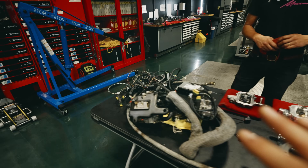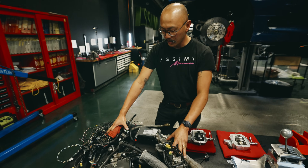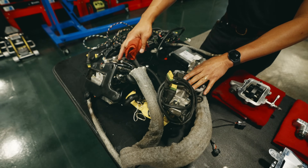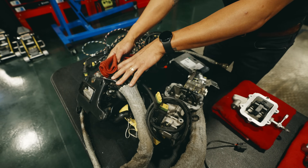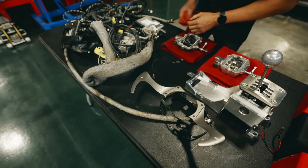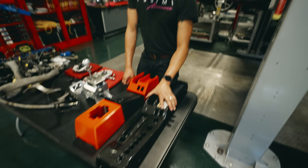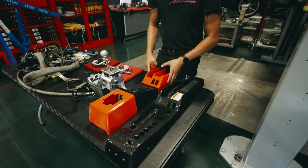Essentially, we've got the F1 system here. This is mostly all the components that come off the car and stay off the car. So you can see the harness here, you have the main power system, the actuator, the F1 accumulator, reservoir, pump, solenoids. You have these pretty little paddle shifters and the ECU. Also the original center tunnel, which we'll go through in another video in the process of 3D scanning and working through the little pieces that way.